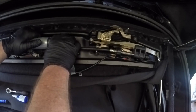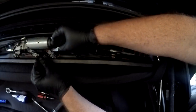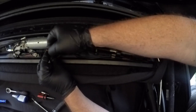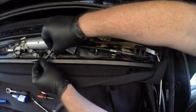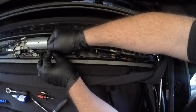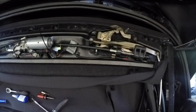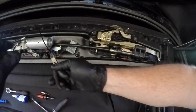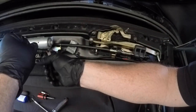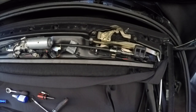This is the same on the other side — it's just a mirror image of what we've just done. Now it's just time for the electrical connector — make sure this is plugged in securely. Mine had a cable tie supporting it in place, so I'm just putting another cable tie here. The last thing I'd want is for that electrical connector to get caught up in that flexible drive coupling and cause all sorts of issues. Make sure you trim up the cable, and there was also that little screw there holding it in place.